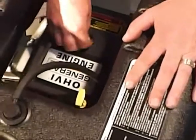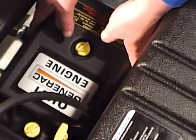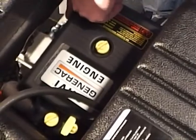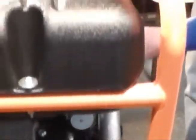They have two caps on top that we can remove. When they made this, they have two little plastic flaps on each side of this cover, and we're going to have to deal with those because the hose extension comes out this side — when we hook up the secondary regulator, that flap will be in the way. Also, if you look on this side over here, there is an electronic choke that's under this unit. When we install the adapter, it's going to end up extending that out about an inch and a half, so it will end up interfering with that. So we're going to have to cut that — you can cut it by either grinding or using a saw.